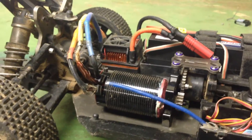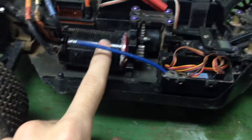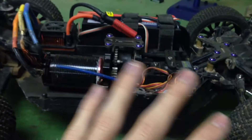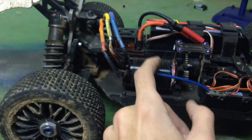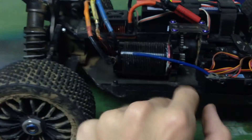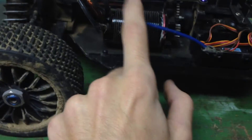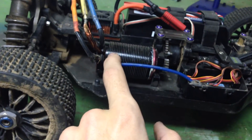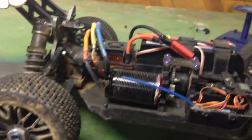If one of your wires is hot, definitely try this out. If your motor gets hot — not from overheating from gearing, but if you plug it in and run it for less than a minute and it gets super hot — try this after you've troubleshot everything else like gearing or binding. If your motor is heating up out of the blue and you take it out of the car and it still heats up, most likely it's either one of your bearings going bad, a broken motor magnet — I have a Loctite Metal video on that — or it could be this wire problem. Check the wires first once you've ruled out the drivetrain. Comment, rate, subscribe, and I'll see you later.